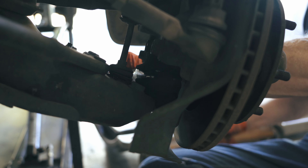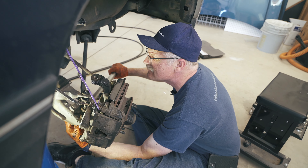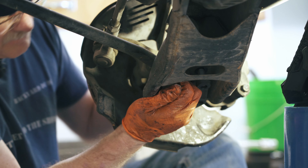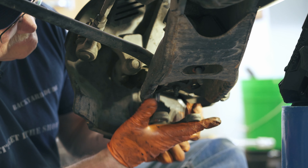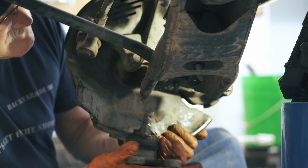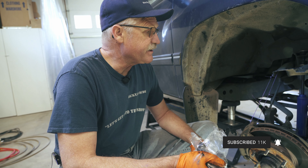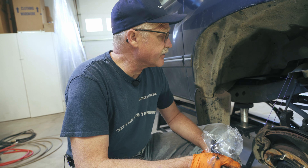Right down here there's a cotter pin, and it was put up against the back wall of the arm. We have to remove this nut — it's on there pretty tight — so we put on a bar that adds a little extension and gives a little more torquing ability. We're specifically taking off this lower ball joint bolt. Okay, that went pretty easy — look at that.